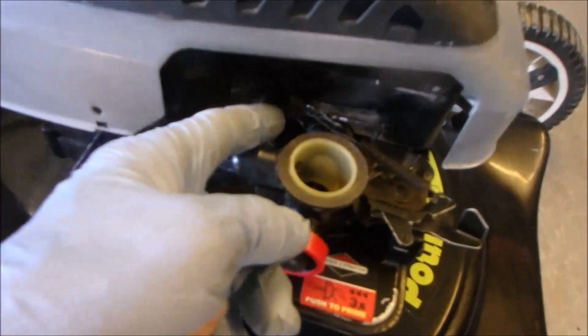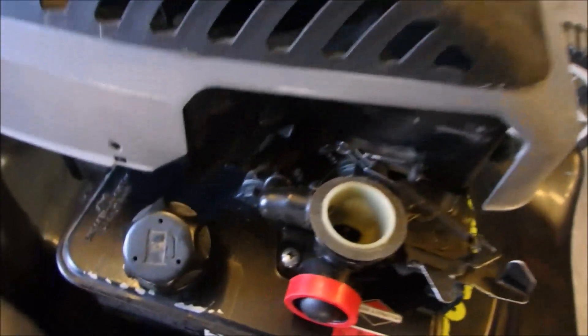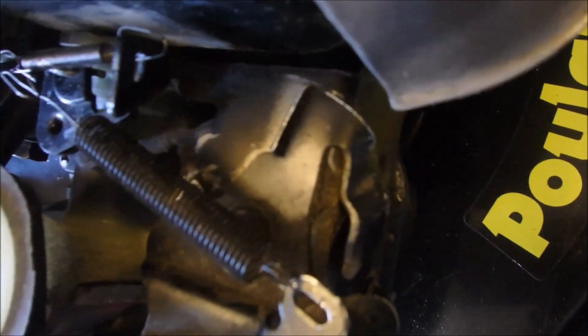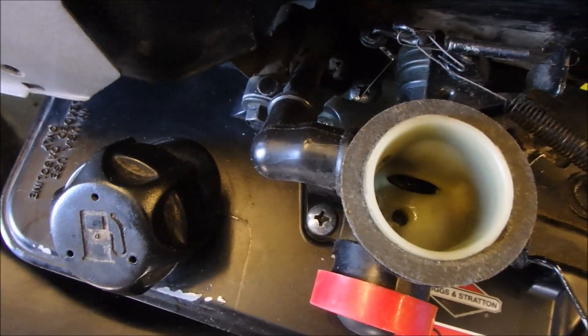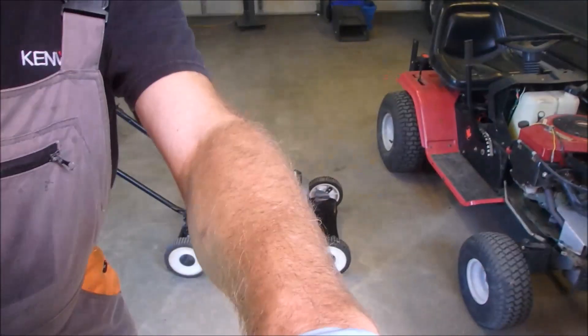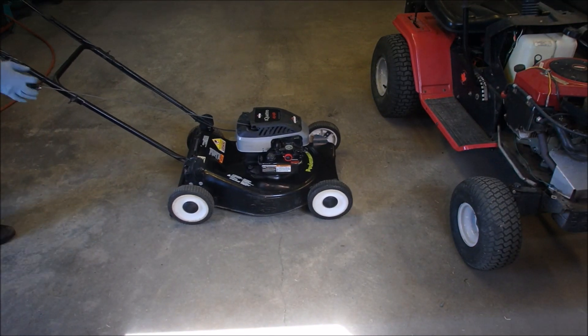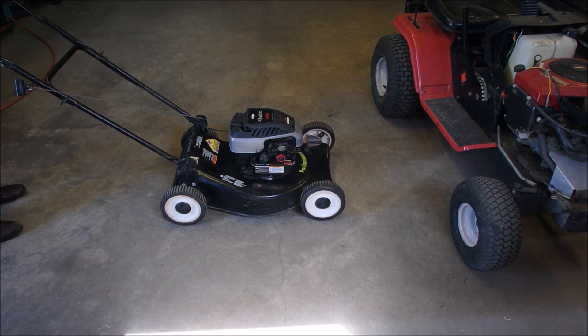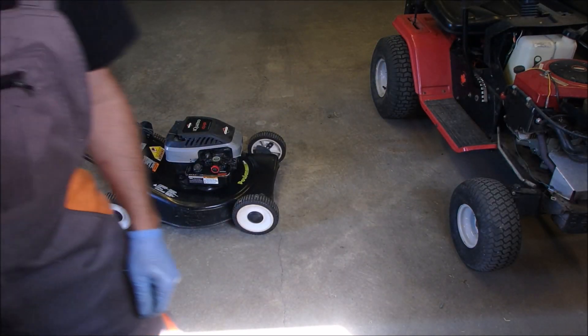Alright, this is the carburetor, and two things were happening. This is the wind vane governor I showed you — underneath it was sticky. Plus it was running on such low throttle it would hardly catch. Since I don't have a throttle cable and this is going to be my back-alley lawnmower, I just bent the tab so it would stay at about ninety percent throttle. Let's crank her up and see how she goes. I don't like fiddling on them while they're running, so it's a bit of a back and forth thing. I think that's done — thanks for watching.